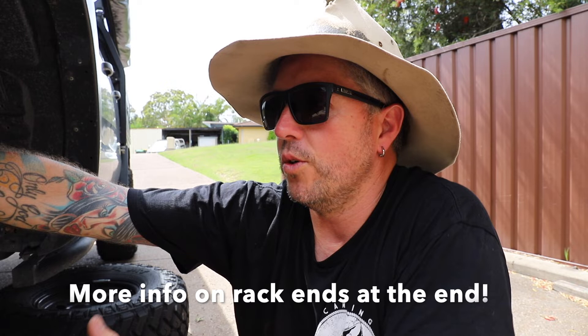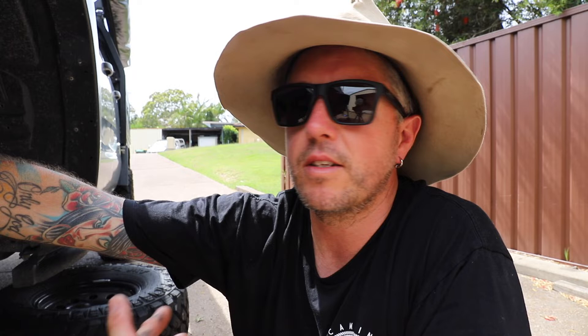Roger and the fellas over there have basically done all my wheel alignments on the car for its whole life, so they've got all those numbers on file to compare. But every time I go there they say I've got a bent rack end — and I'm like, yes, I know. So today I'm getting it sorted, all because I couldn't find those rack ends. Drive Tech make them and so does Road Safe, but they are not the same. I went through a whole day trying to change them back and forth between here and All 4x4 at Katara, and they just were not the same as the factory ones. So if you're going to change out your rack ends, I'd recommend getting factory ones — same as your CVs, they're the strongest ones as well.